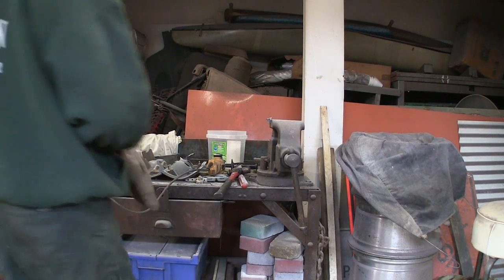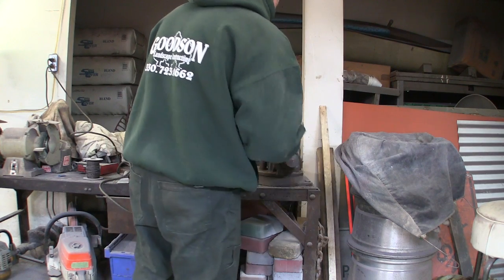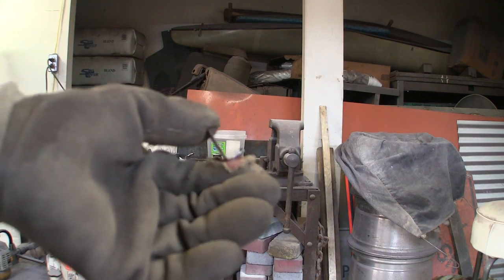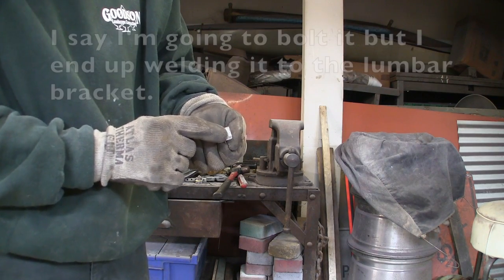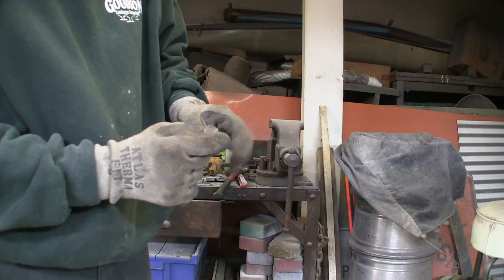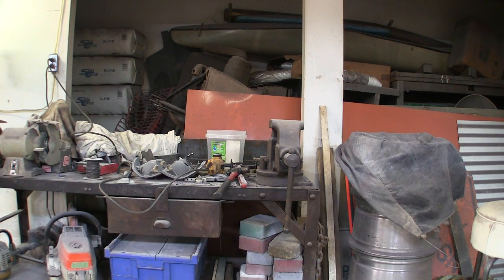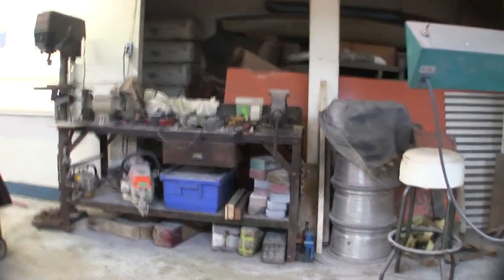I started to make this new piece here. I cut a little piece of 18-gauge sheet metal and put a 90-degree bend in it. I'm going to drill a hole through the bottom to bolt it and a hole through the top to put the loop of the spring through. I'll move you guys back so we don't get any sparks in the camera.